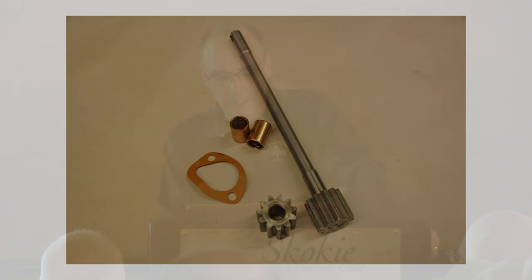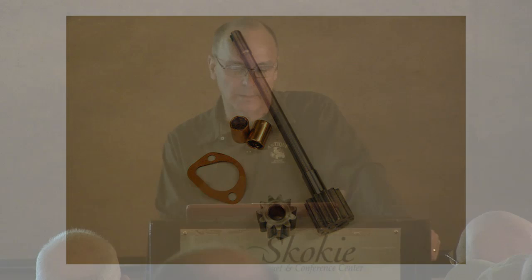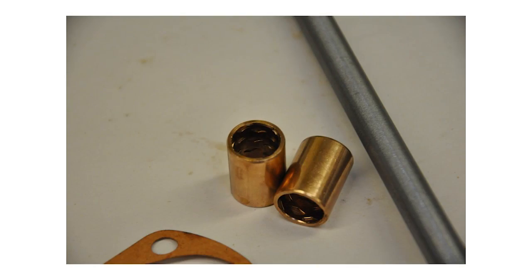Our oil pump kits — we have our own oil pump kit with a cut-down shaft at a very economical price compared to other kits. The step-down shaft does help improvement, depending on your oil pump. The step-down shaft is mandatory on the Model B engine oil pump. And here are the bushings for the oil pump.